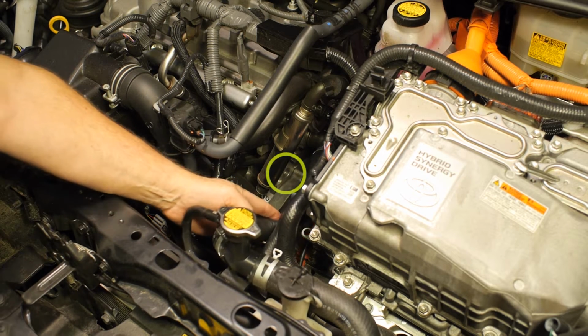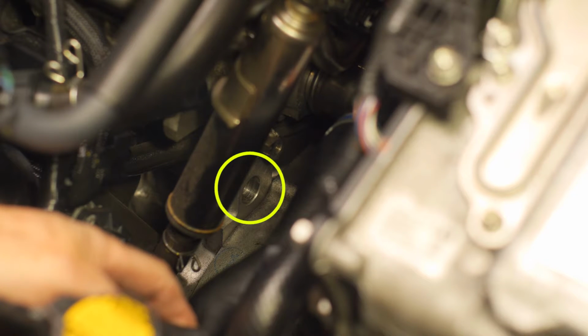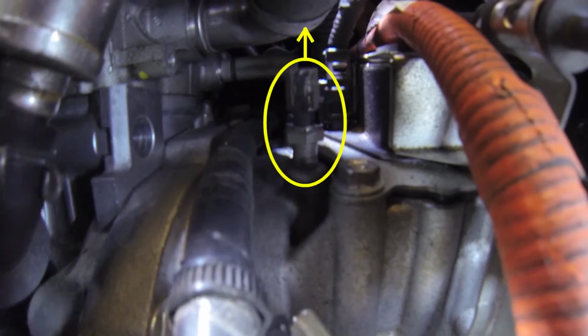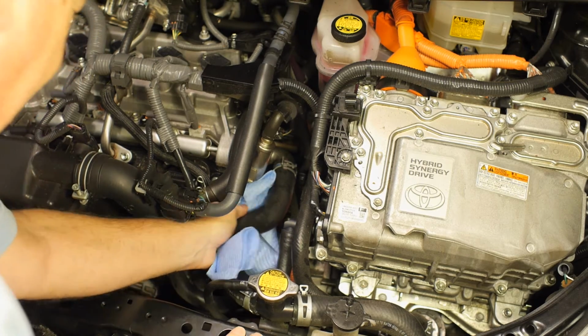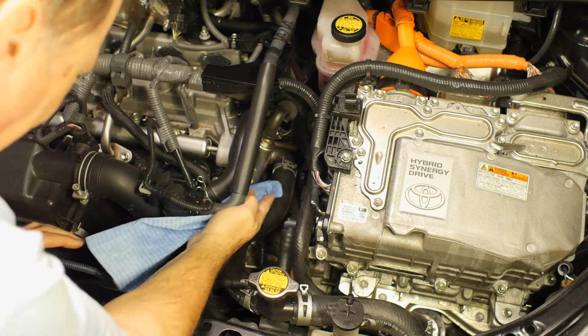The heater element slides into this hole on the side of the engine block. That's the right side of the block, as seen from our vantage point at the front of the car. But there's a hidden snag under there. There's a breather valve sticking up from the transmission housing that's in the way. We're going to have to remove that valve to give us room to insert the heater element, then reinstall it once we're done. You might want to wipe down the hose in the area underneath before you get started. You'll still get your hands dirty, but maybe just not quite as much.